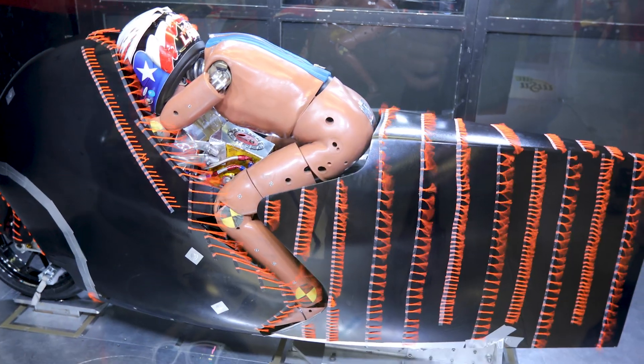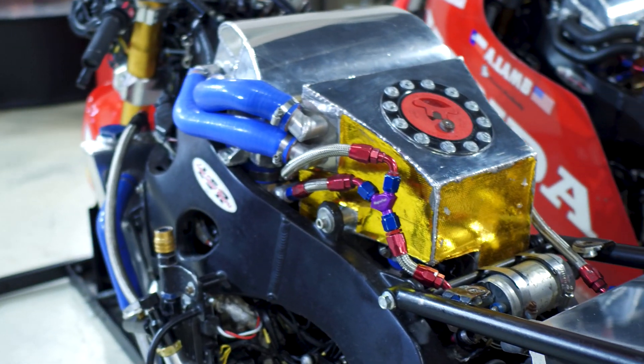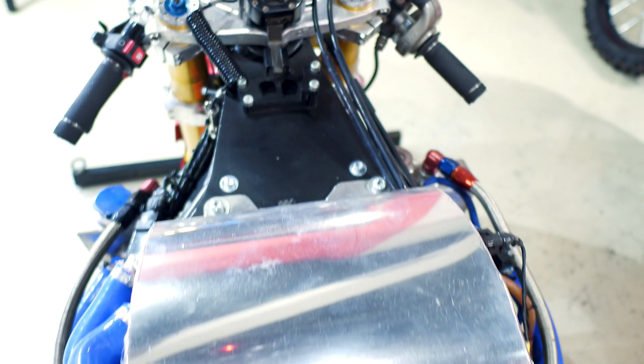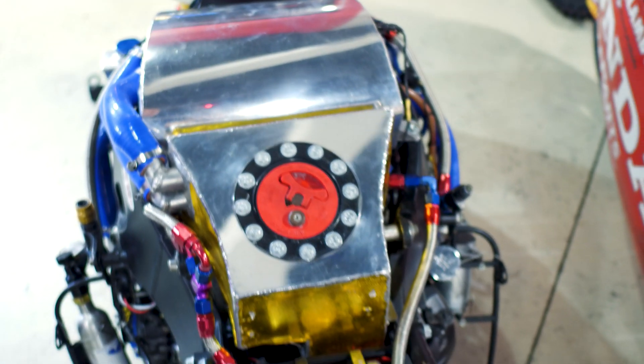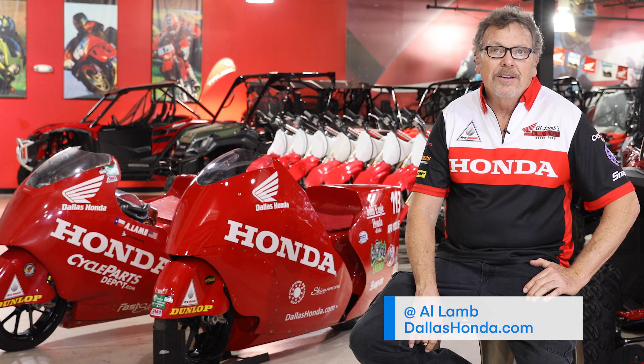The new body we have on Big Red now, which was built after our last Bolivia event, is about 18% slicker than the body that went 285 miles per hour in Bolivia. At this point, we have our own body molds which we build. We also build the custom water tank in place of the radiator, the air-to-water intercooler, the fairing mounts, the rear subframe and fuel tank, the ice water tank that runs through the intercooler, as well as all the mounting parts for all of it. There are a lot of proprietary, single one-off pieces on this bike.